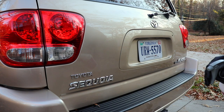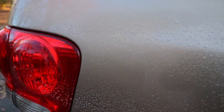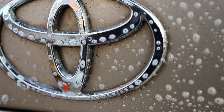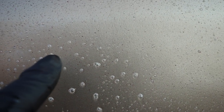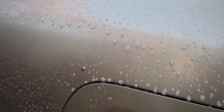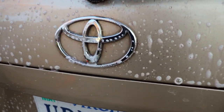Is this product safe to use on paint? Sure it is. You can put it on dry and let's see if we get any reactions. Ideally you want to do this after you wash the vehicle, but I'm doing this for demonstration purposes to see how well it dissolves particles. You can already see it starting to react — there are bits turning purple and bleeding, especially down here where there's a heavy buildup of iron ferrous particles. Overall it's not horrible, just little tiny dots turning purple throughout the panel. You can tell it's a nice thicker foamy formula that really clings to the paint. Of course, don't do this in direct sunlight — work in shade, or if you must work in sunlight, watch the panel and do not let the product dry. It's doing a good job breaking down these particles.